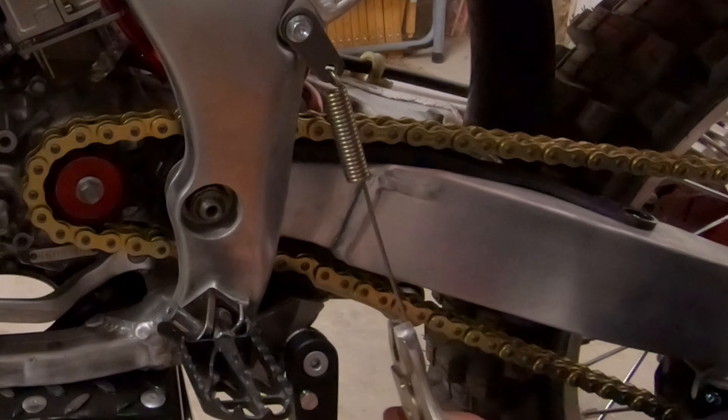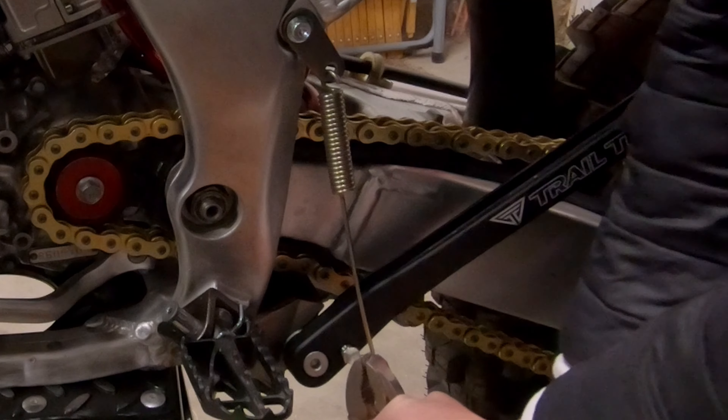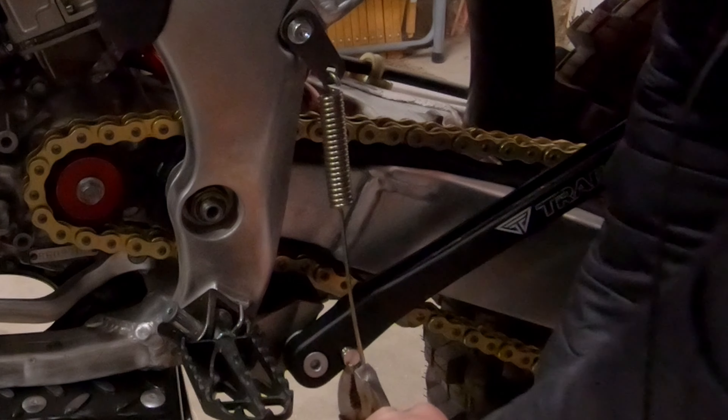We also have to put this little spacer here for the spring, which goes with this bolt right here for the subframe. Just need to get this little rubber piece off and we can get the spring on. Got some vice grips — I'm going to get it started, put it in, and if we pull the kickstand up and get it closer, it'll go on when we release. Just need to give it a little tap. There you go — this is how you install the kickstand. Super simple, super easy, and very useful. You can see it goes up super high and it's out of the way.